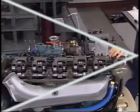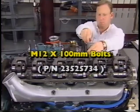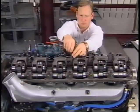The rocker shafts must then be attached to the cylinder head with M12 by 100 mm bolts, part number 2352 5734. Be sure to torque the rocker arm bolts to the specifications in the manual.